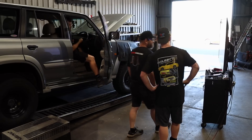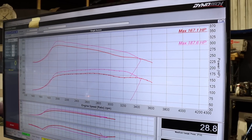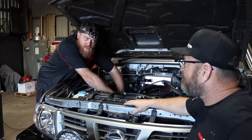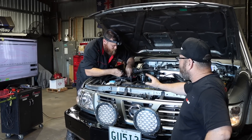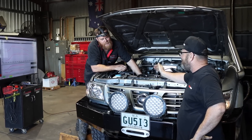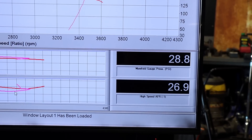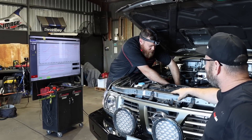We just did another run — we took some shims out of the pump and it's picked up power, pretty much 20 horsepower on the banger. We've still got some shims in there so we'll have another crack. I only went about half of them — I just wanted to see if it was going to respond. It didn't make any difference we'd leave it alone, but it's responding which means the pump's got more legs left in it. So we add fuel, that fuel makes heat and drives the turbo harder, so we end up with a more efficient engine — even though we're technically richening it up, that turns into turbine power which makes more boost. Our boost has gone from 26 to 28 pounds — jumped a couple.